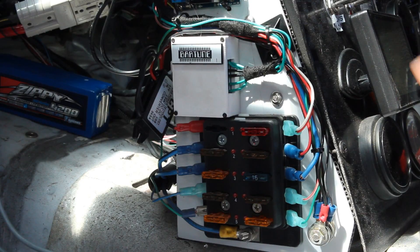The ECU is now able to control the pump to target temperatures that we have set. Hopefully once the car is up and moving, there will be enough airflow through the radiator that the water pump will just need to pulse on every now and again to keep the coolant at the right temperature. That's because it is now replacing what the thermostat used to do, so it's quite important that the pump does its job right.